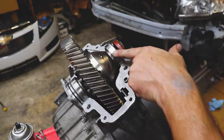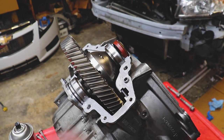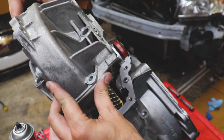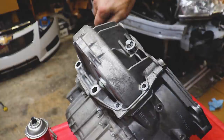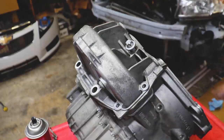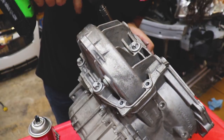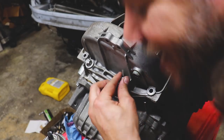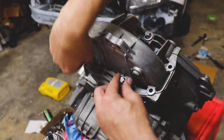We've got a little seal around there. We'll put the axle seal back in. Let me double-check everything — races are in, shim is in, end cap seal and axle seal are all in there. We'll toss the cap on, take the four big bolts and snug it down by hand. We'll let the sealer sit for about an hour, then torque it to spec. It's been an hour — let's remove these bolts, put some red threadlocker on them, and secure everything down.